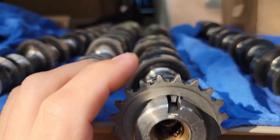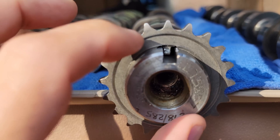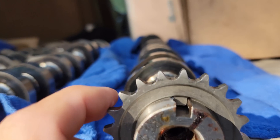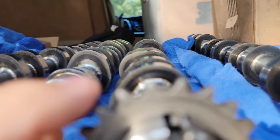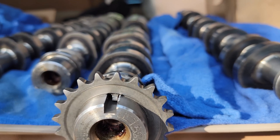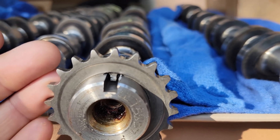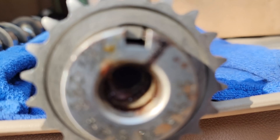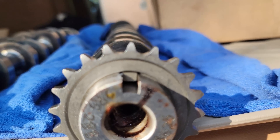Now let's look at the cam that has the modified keyway and the amount of slack. If for whatever reason the washer and bolt don't keep the tension like when originally built, look at the end of the key and look at how much movement there is. Imagine you have very tight piston-valve clearance dialed in, and for whatever reason this bolt gets a little loose — you're spinning at 6,000 RPMs on the two-step, hitting a limiter — and this retaining situation isn't as robust as it first was. It happens to walk. I've seen it happen in the millwright world a billion times.